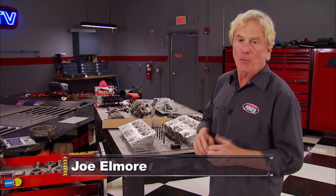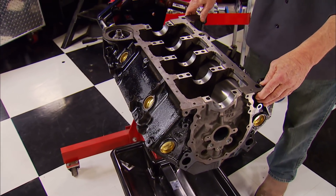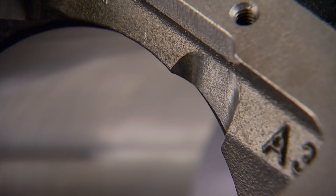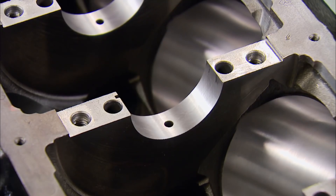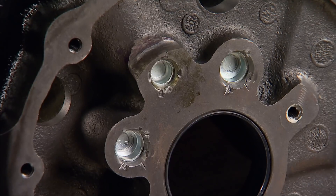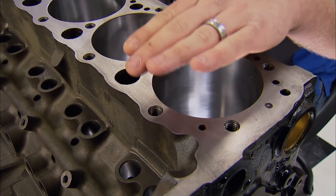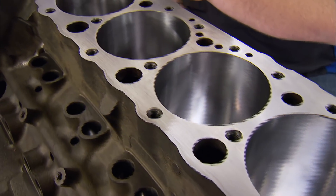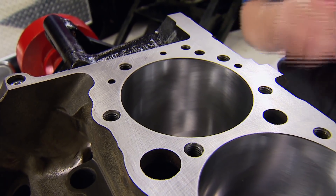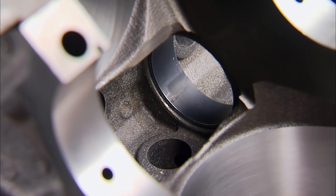When building a race engine, the parts are important, but it's the way you prep and clearance them that really counts. Since Chevy made over 90 million small blocks since 1955, this was a no-brainer for our base. It's been clearanced for a stroker crank, bored 30 over, then line-honed with four-bolt mains because we replaced the bolts with studs. The freeze and oil galley plugs are all new. The block was also milled at the machine shop to ensure flatness and squareness, provide a nice smooth surface for the head gasket seal, and set the piston five-thousandths in the hole.